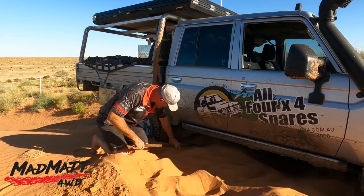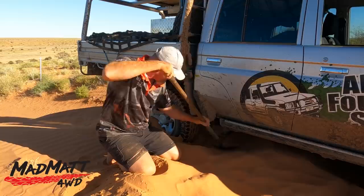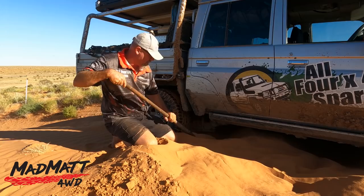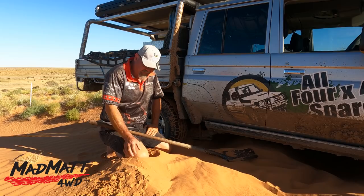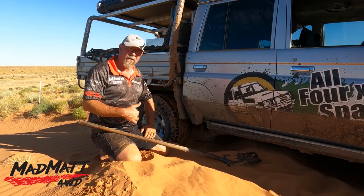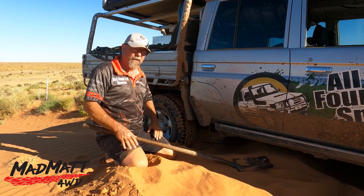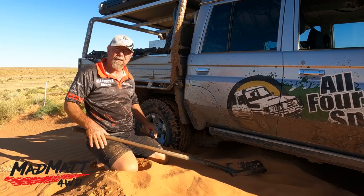So I'm going to do the same thing again - dig myself a hole where it's easy, and then pull the sand into it. We're currently about nine o'clock in the morning, still quite cool. The sand is quite firm compared to what it gets to in the middle of the day - it gets very light and fluffy. Whenever you're doing a recovery, especially in a situation like this, be well aware of your personal rehydration - drinking plenty of water and sharing the load amongst those who are with you. If you're doing this in the heat of the day in a hot environment, you will consume an awful lot of water.